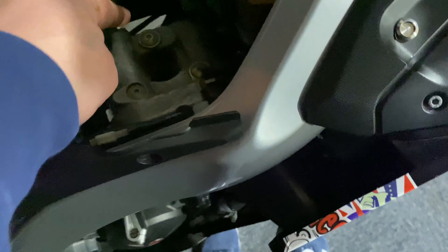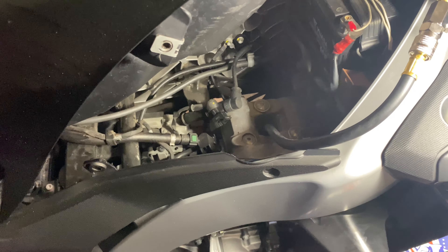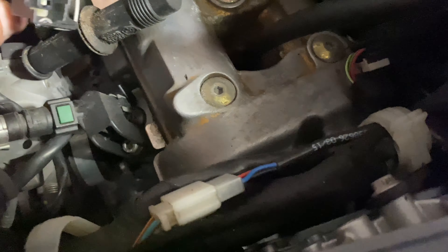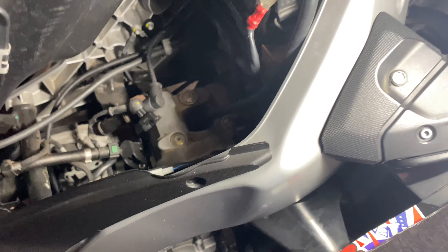So I'm going to disconnect the fuel injection off camera and then screw the 10 mil adapter from the compression tester into the spark plug hole. I've stuck a lamp on to try and give us some light. I've disconnected the fuel injection signal and screwed in the compression tester. I didn't get the engine completely hot but I did warm it up.